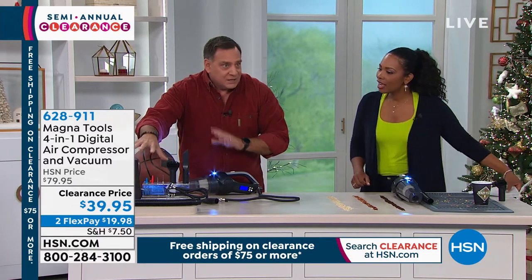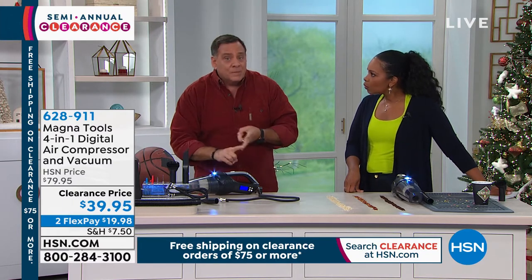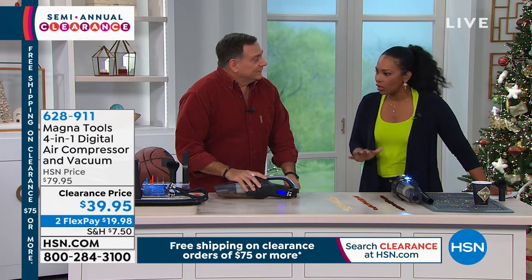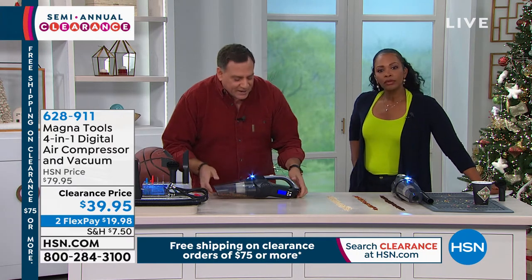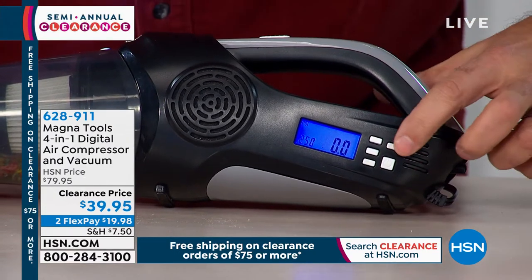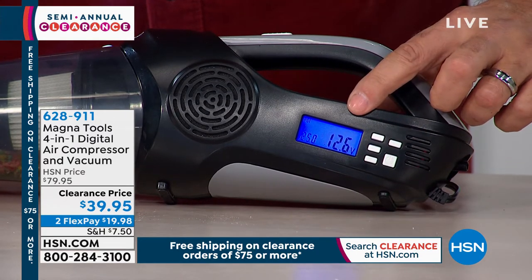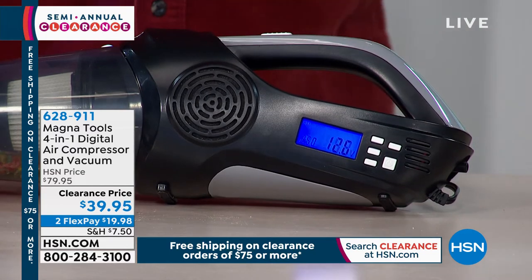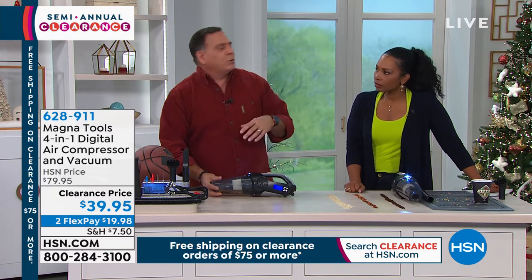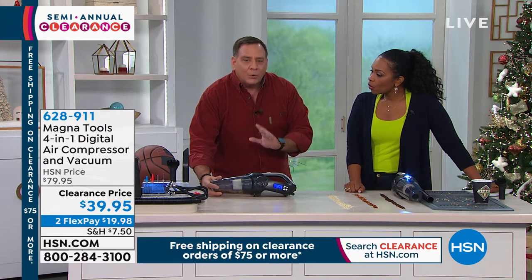You're getting all the tips and everything you need in this kit, plus a carrying bag. I like that because I just leave it in the car and I know if I need to fill my tires, vacuum, or check my alternator, I can do that. You can still get it in time for Christmas if you want — you'd pay an extra $12 in shipping. Now if you look at the display — it's showing pressure, but if I press this button, that changes over to the voltmeter. Right now it says 12.6 volts. A battery in a vehicle should be somewhere between 12 and 12.8 volts. When it's charging it'll be higher — if your car is running, it might say 14 volts. If it's less than that, you've got a problem. All you've got to do is plug it into the power port. It's a very smart device.